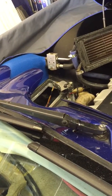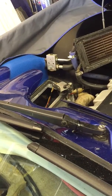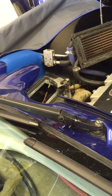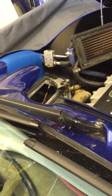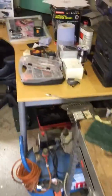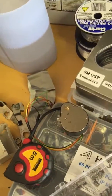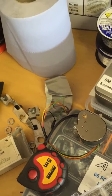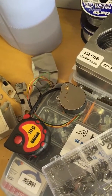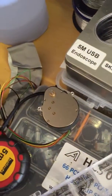It tries to drive through that 90 degrees on each ignition cycle, and as a result, the arm that connects the motor arm to the flap that adjusts hot and cold is basically bending — it's an aluminium rod. I had to change the heater motor because the last one had apparently over-rotated, according to TVR Power, and was faulty. I think the gearbox was knackered, because basically every time it goes through an ignition cycle, it's trying to go through 90 degrees and putting stress on the mechanism inside the gearbox as well as the arm.